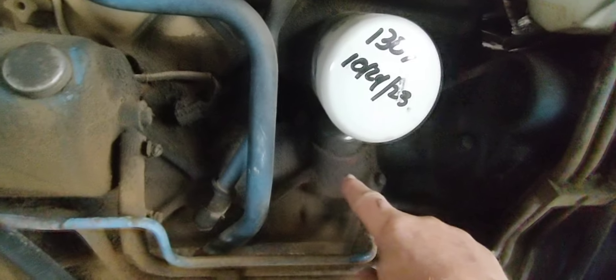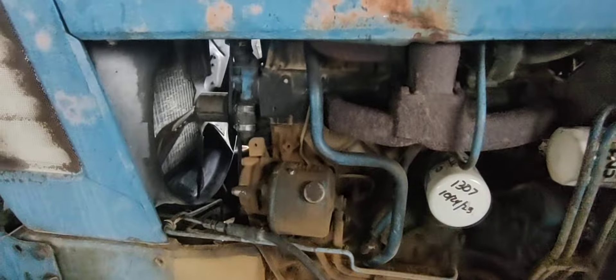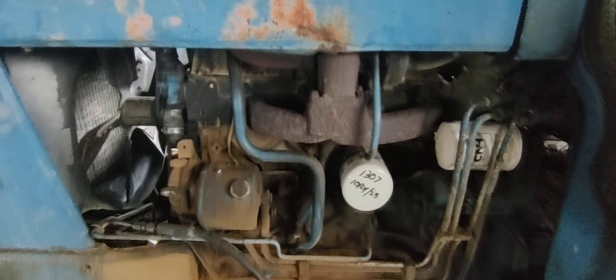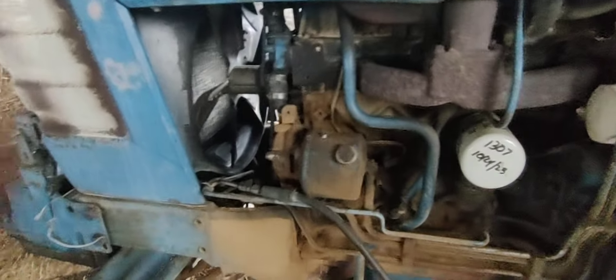There's a short cable that goes from the tachometer down onto the oil pump shaft. I kept shearing these cables, and it turned out something in the tachometer was seizing, which would strip the cable and eventually broke the input into the tachometer. That's how I finally figured it out and got it changed.